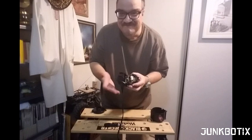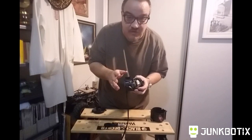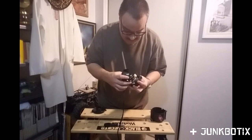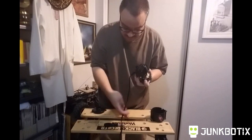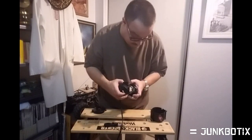You can run this off DC, but it's got to be somewhere around 100 volts DC if you want the same speed out of it. It might actually run on 12 volts — it'll just be really slow with no power. Since it's all connected to just this micro switch, I'm going to put it back together and plug it into a 12-volt power supply to see if it'll turn on.